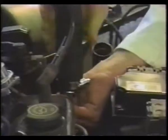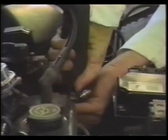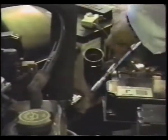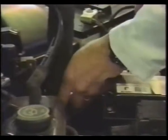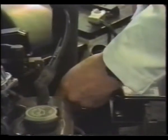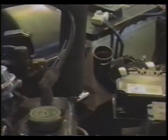Step 2. Disconnect the top radiator hose from the radiator and connect it to the inlet pipe of the analyzer. Connect the outlet pipe of the analyzer to the radiator. Use reducers, hoses, and elbows as necessary, and be sure all clamps are tight. You will note that the Briggs Engine Cooling System Analyzer comes equipped with an assortment of connectors and reducers to be sure that you will be able to hook it up to any size radiator having a 1 1/4 inch to 2 inch opening.